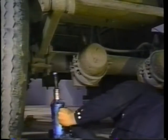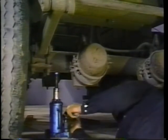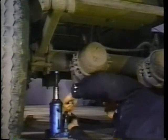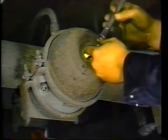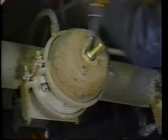The brake linings on this trailer were measured and found to be near the minimum safety standards. We'll begin brake maintenance on this trailer with the brake inspection. To prepare the brakes for inspection, raise the vehicle using jack stands under the axles. The spring brakes are then caged — that is, the manual release mechanism on the brakes is set in the release position.